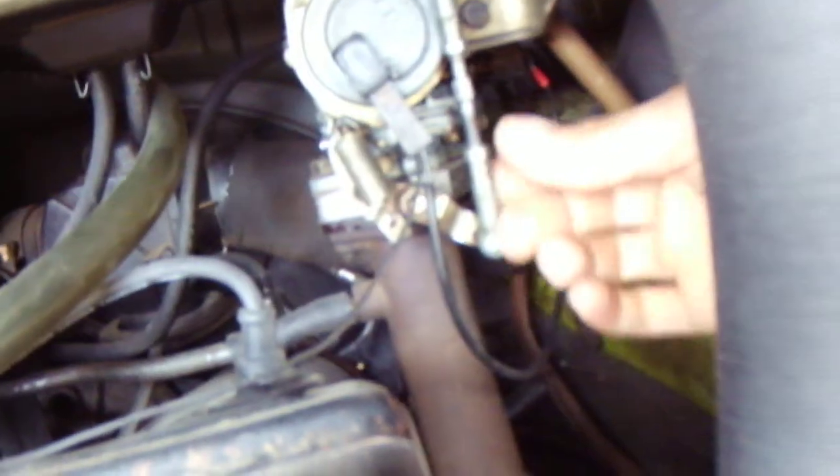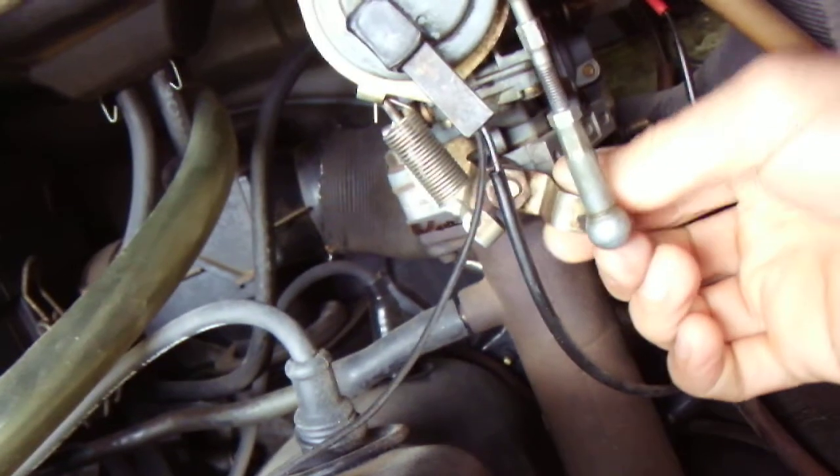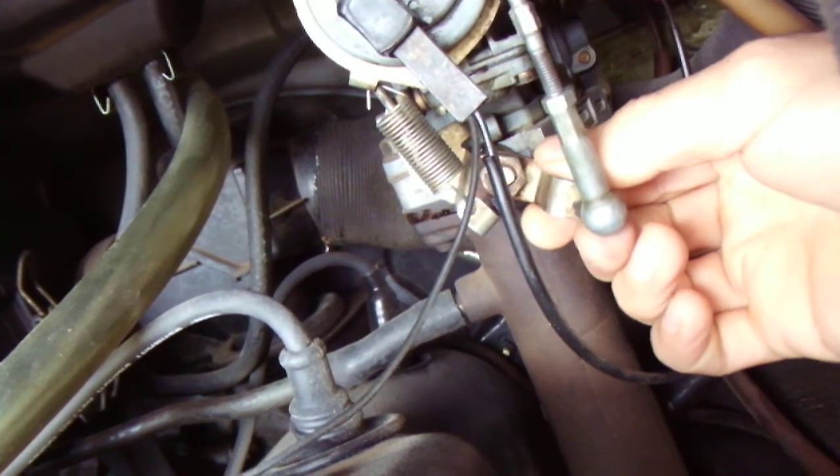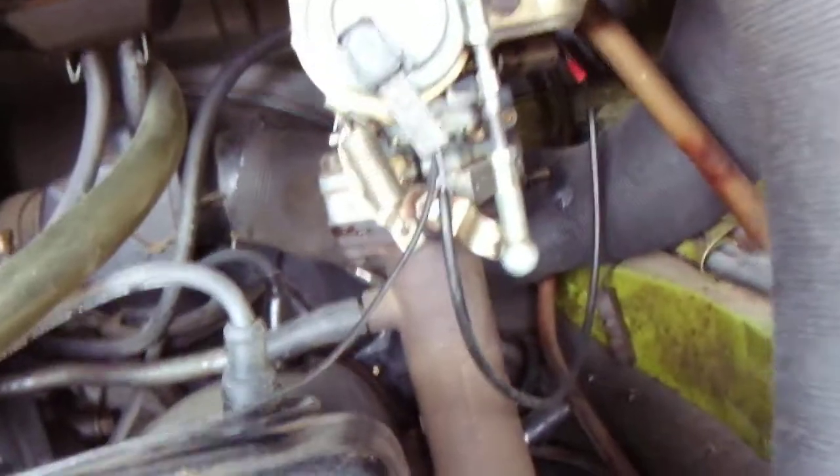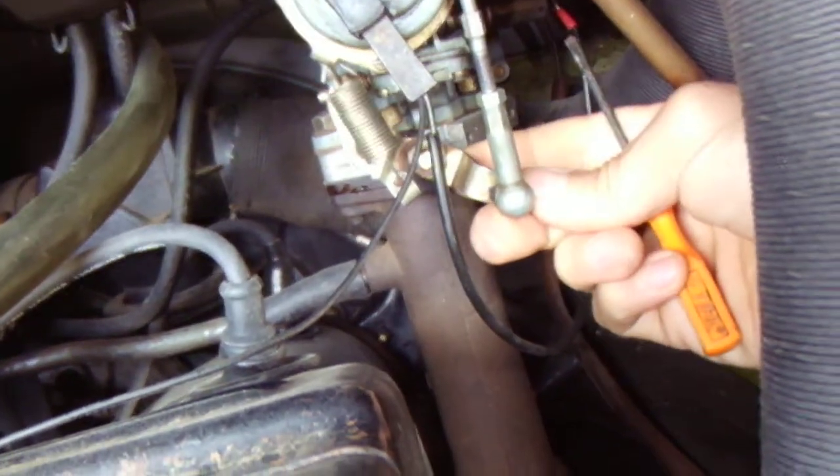Let's have a look in there. Check these hoses — that's a T-piece I replaced from the fuel tank. If you find the hoses, there are many more in there where the fuel tank goes. This should all be replaced if you have any fume smells. Carburetors — check the linkages. There's a bit of play in this one here. I actually cleaned these out and replaced all the seals and gaskets in them. That plate doesn't bother me too much, but it's something I'll have to look at in the future — not leaking or anything.